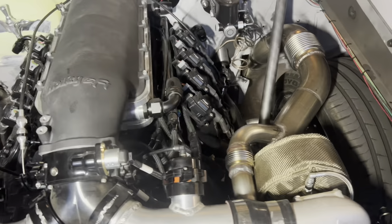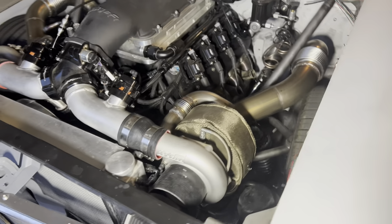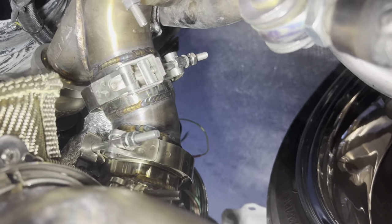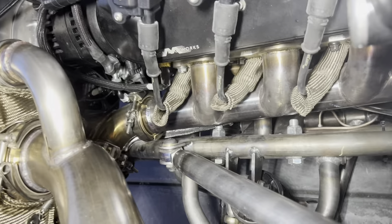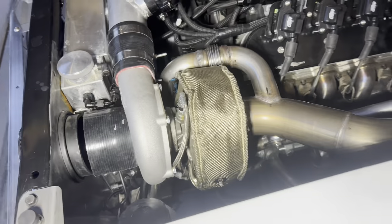Here's where we are today. This morning, after getting the car home and unloading it from the trailer late last night, I found there were actually a few exhaust leaks up here. With a turbo system like this, we've got V-bands galore. Those stainless steel headers have three couplers of different radiuses that allowed me to achieve the turbo placement. Every one of those has a V-band and clamp — a potential place for a leak. I had a couple.